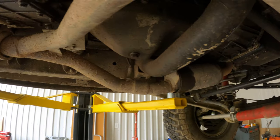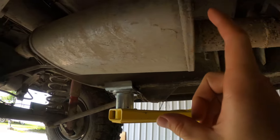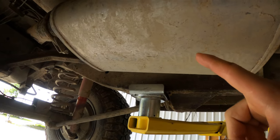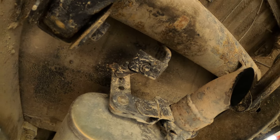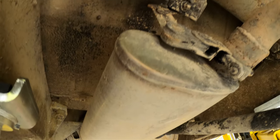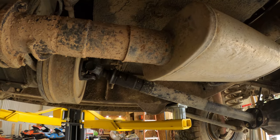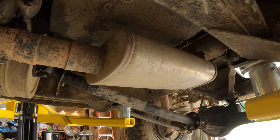So next thing you could see is the exhaust. Factory Y-pipe to a full custom system here. Basically it's just a short little pipe that I welded up, which adapted to my Magnaflow 14-inch muffler, which just goes to a turn down. It uses the factory mounting location, although with an aftermarket hanger, because that's the best thing that I could come up with. I definitely like the sound. It's actually not as loud as you would imagine it to be for being so small.